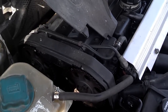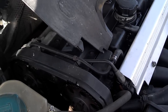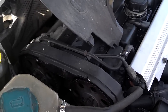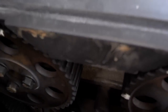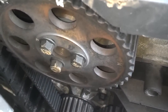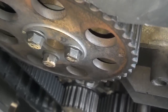Now, this car, like many other newer vehicles, has what's called an interference motor. What that means is, if this car jumped time or the timing belt breaks for any reason, it will cause damage to the head of the motor, requiring the motor to be rebuilt. Some people say they can look down at the timing belt and see if it's any good or not — I think that's a myth. If you don't have written, documented proof that it's been replaced, have it done.